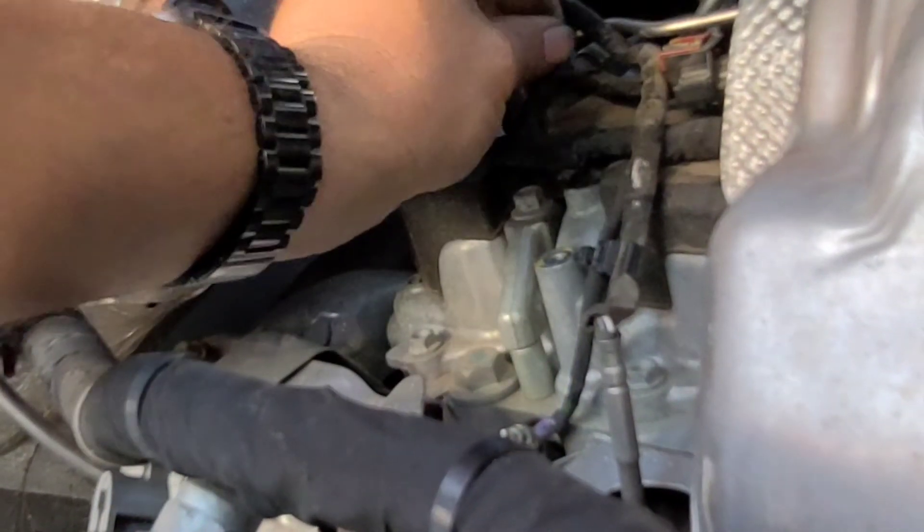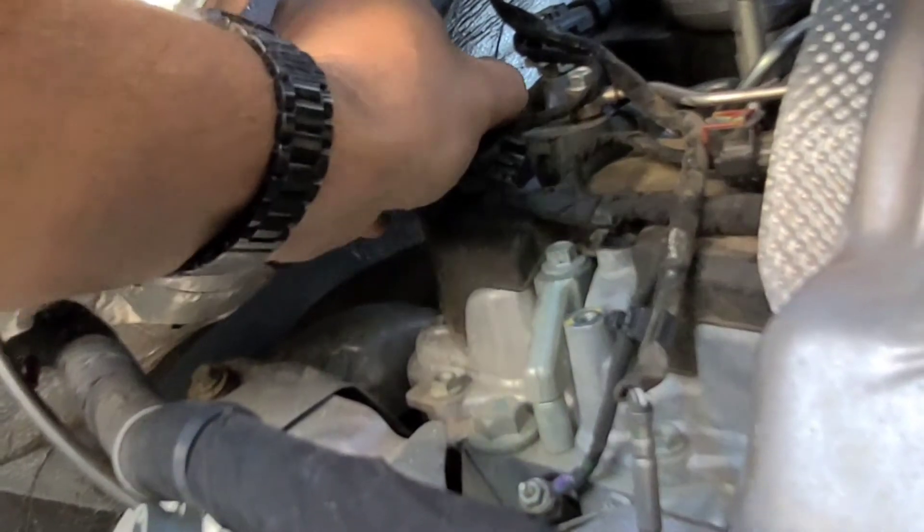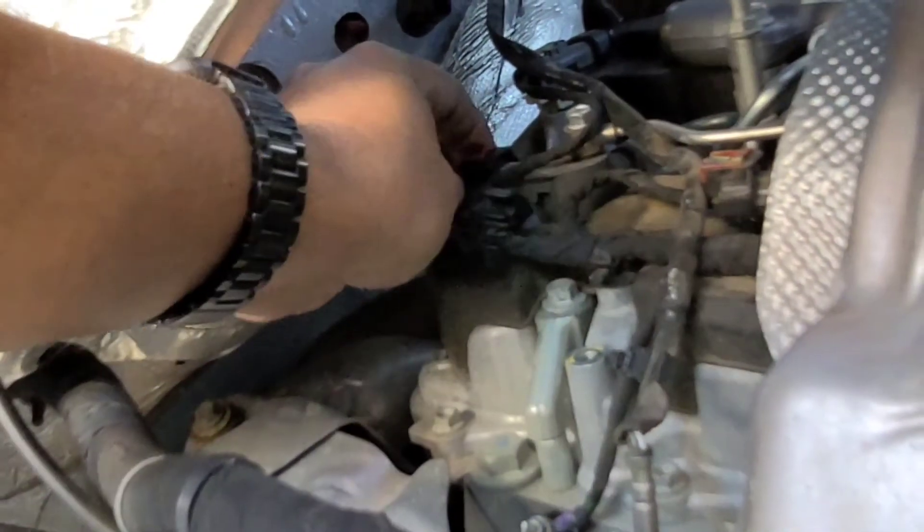To get this connector off, I'm going to pull this up and hook it right there on that bolt. There's a tab right here — you push that tab down, get your thumb in front of that red connector, and slide it back. Just like that — push this down, slide this back, and then it should come right off. So I got the old connector off. This one was just replaced in April and it is now the end of August. When I got it off, I pulled against it a little bit and it pulled off. I kept pushing harder and harder and finally the top part broke off, but when it broke off it did go back far enough to get it undone — regardless, it is off.